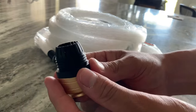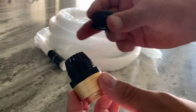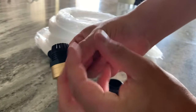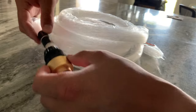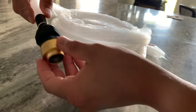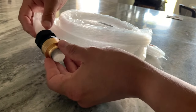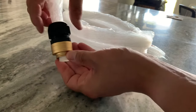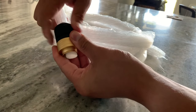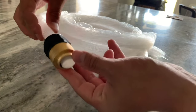When you unscrew it, you'll see that there are little notches on the end. So the way this works is this end goes into the light engine and this side grips onto the fiber optics. First you're gonna put the cap on there a little bit, just very lightly. You stick the fiber optics in there. Now, normally it can scoot as high up or down as you want, and it's gonna do that until you tighten it. Once you start tightening the top, you're gonna notice that it's starting to grip onto the fiber optics. And now it does not move. It's nice and tight now.